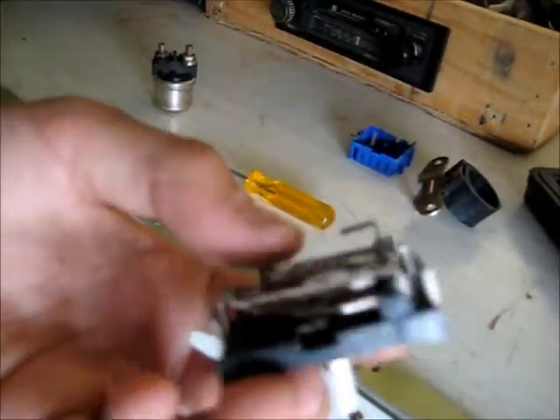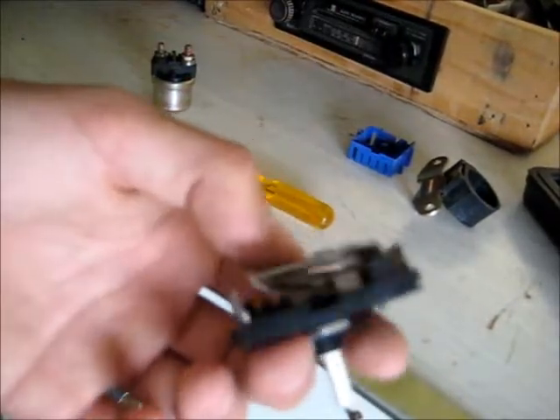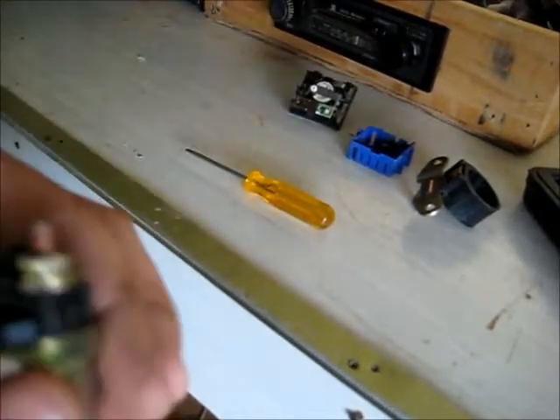Just a big spring in this terminal which closes against this terminal when you have it on flat out. I set the tripod up - I'm going to give you a demonstration when I turn the handle. And this little plastic slug is adjustable, and that adjusts the contactor - adjusts the intensity of it. So that's the thermal type switch. As the hot plate gets hot it builds up current, this gets hot, and it clicks on and off depending on whatever setting this is on, and that's how you'll get your high, low and medium out of that.